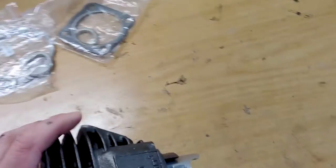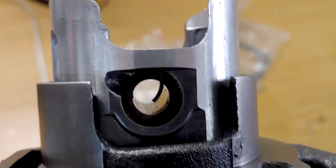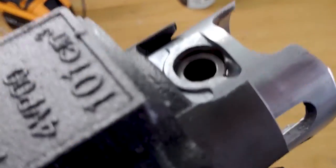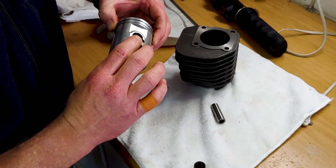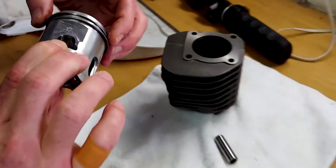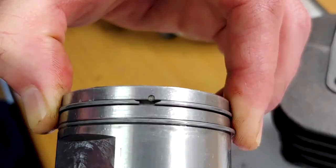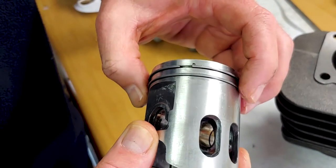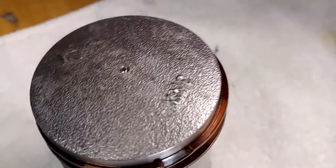Top tip when fitting the piston: fit the most difficult-to-reach wrist clip first, and pre-assemble so you can slide the barrel on easily — trying to compress rings when the barrel is separate is a nightmare. There's not much space on a Bws. What's interesting about this piston kit is the ring setup is very similar to factory ones — there are little 45-degree notches around the pin. Some Chinese ones have the 45-degree area facing outward toward the barrel, which is really odd.